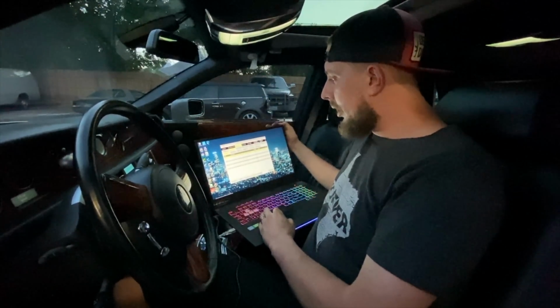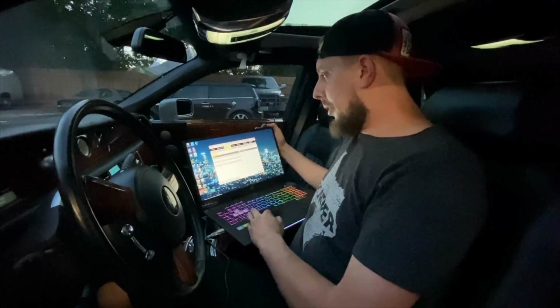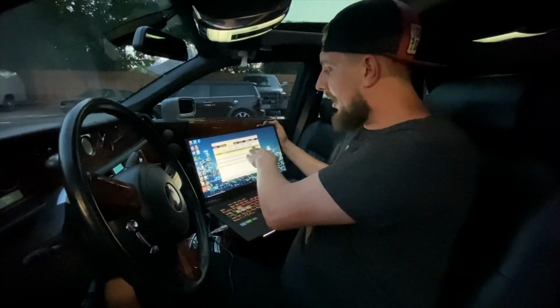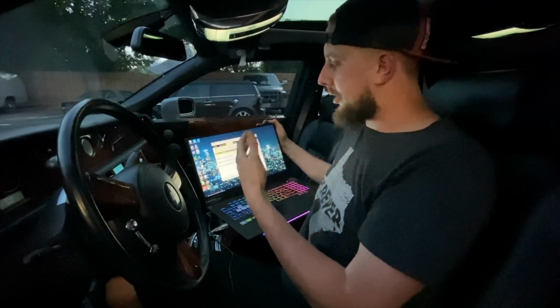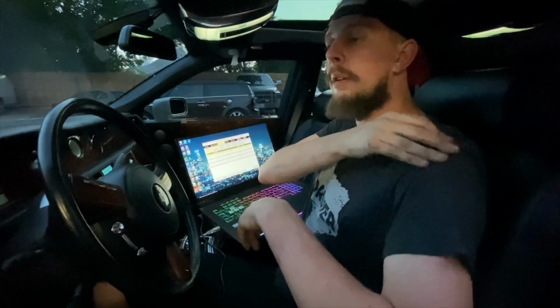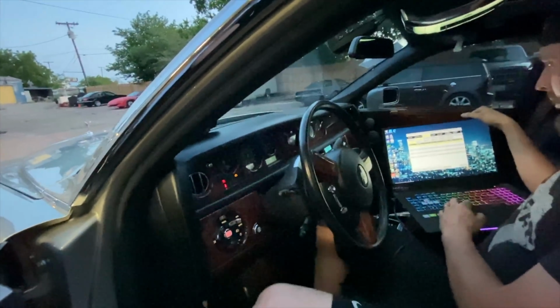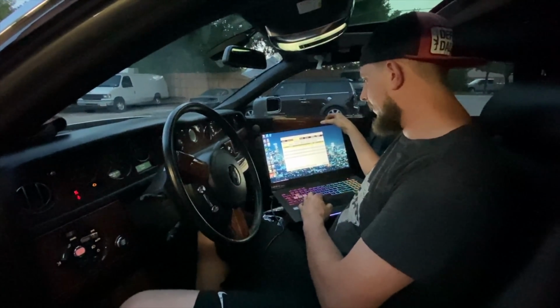We probably need to pull apart every connection, spray it with cleaner, and then plug it back in. What I'll probably do is I've screenshotted where the connection's at. I'll pull the exploded view because, as you can guess, it's time consuming. The only problem I'm really having is that we have these airbag faults, and I keep resetting them, and they keep coming back. They're going to stay there.